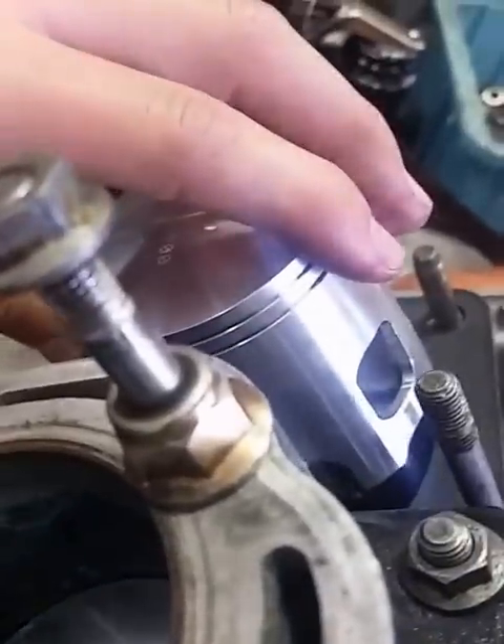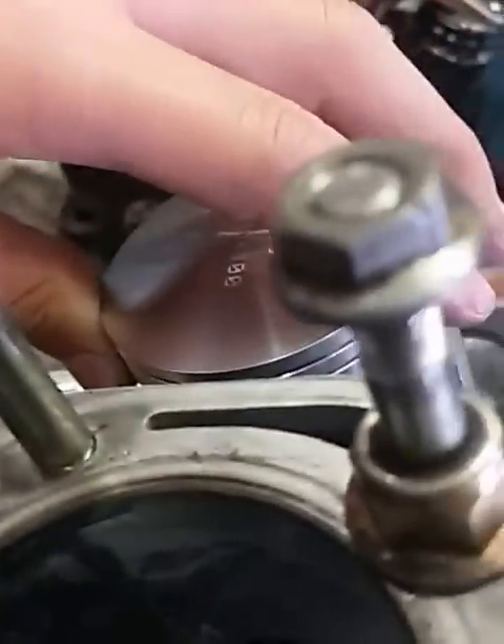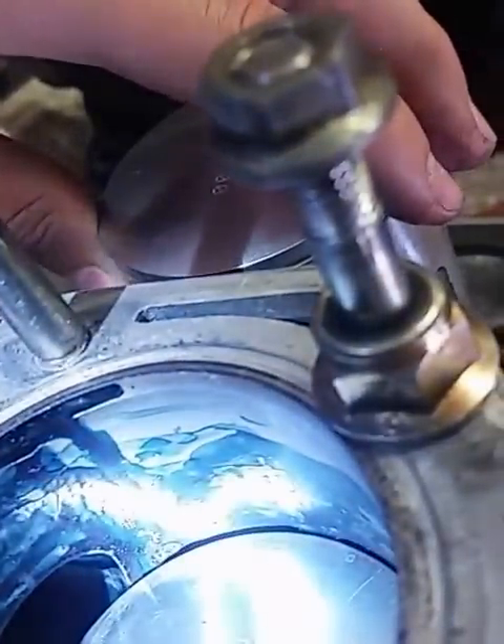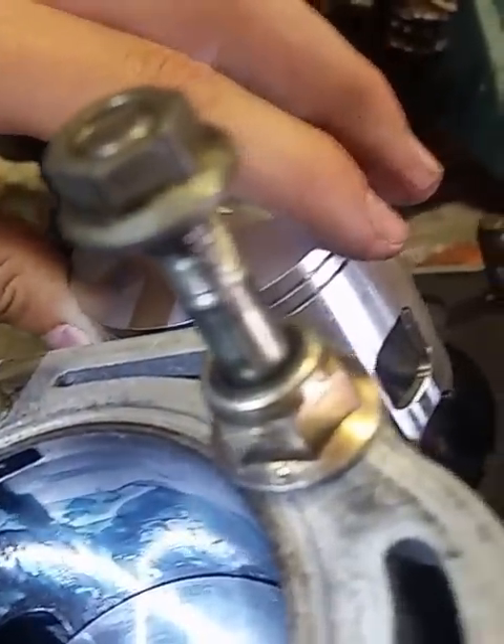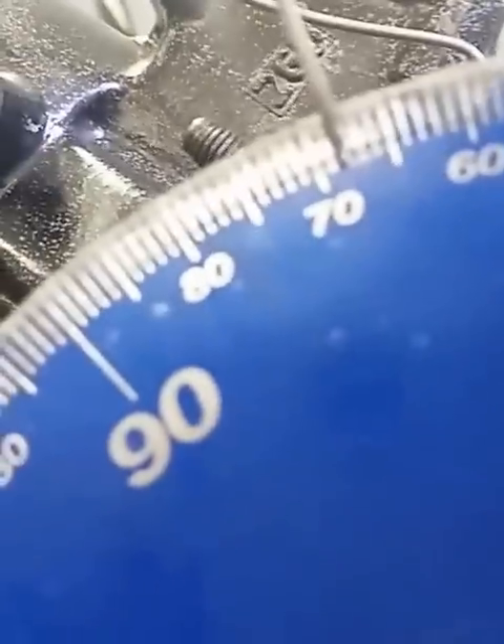So if we come back up to where our transfers open — shine the light in the bore. So transfers are just there. This one is much more simple. If you go to the bottom dead center mark and look at what you are away from it, you are 68 degrees. So 68 times 2 is going to be 136 degrees of transfer duration.